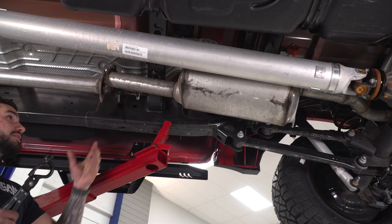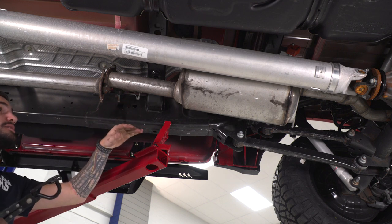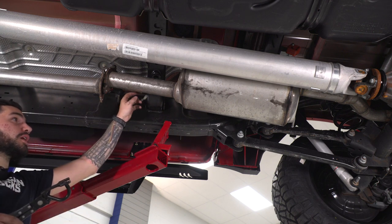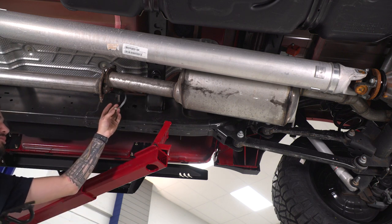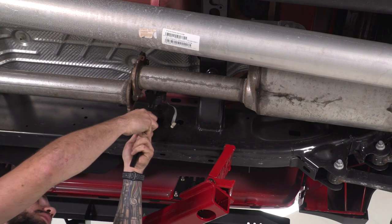Next, we're gonna remove the flange hanger from the isolator on the frame. I've got my buddy Jared at the tailpipe tips to help. I'm also going to disconnect the ground strap, which just pops right off — that hooks around to connect the frame to the exhaust. Then use the hanger tool to pop the final hanger out of position.